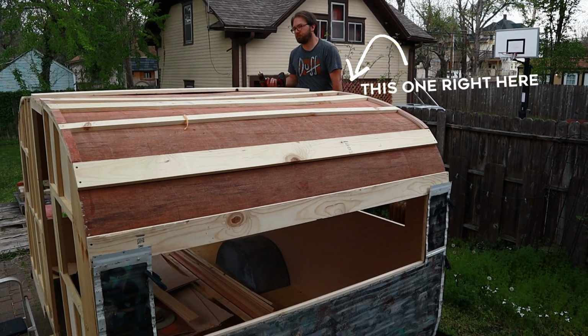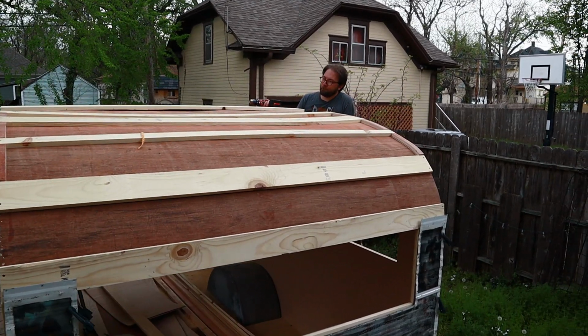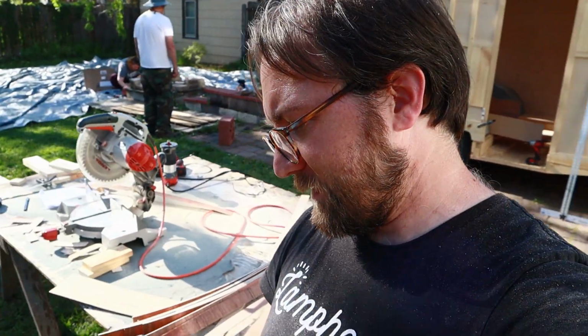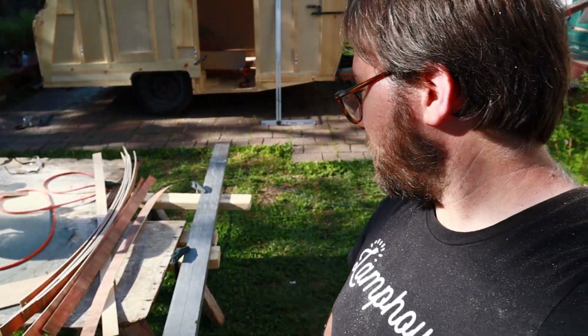Okay, so try to fix that bowing ceiling joist. I'm going to add some aluminum angle to it. The old camper actually had this really beefy piece of aluminum channel that came from Martin Marietta Aircraft Corporation. So this could be some pretty tough stuff.